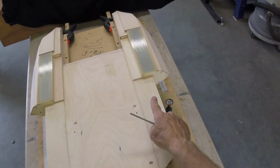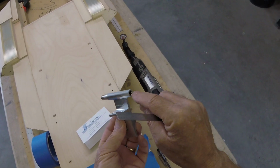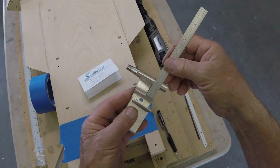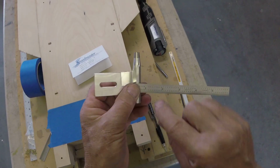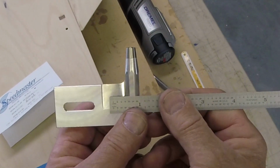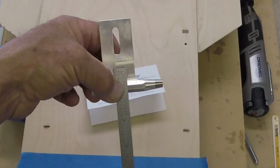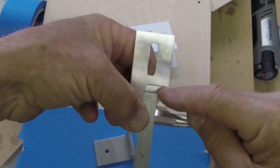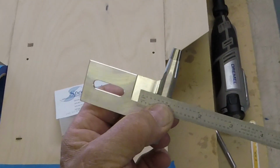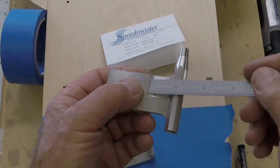You remember we made a super low ride height here of 3/4 inch. So we want the center line of our drive dog shaft to be at 3/4 inch depth. 3/4 inch, I'm gonna guess here, maybe you'll be able to see it. It's the number 24 on here. I'm gonna kind of guess the center line of this strut for poops and gales, right about there. You see the problem? This taper is cut well above that. They expect you to run a really deep strut because that's what everybody did back in the day. Speedmaster still builds their stuff that way. So we have this massive cutout